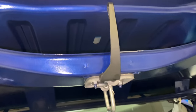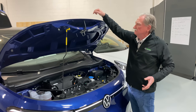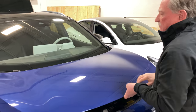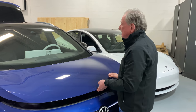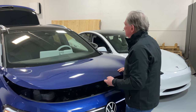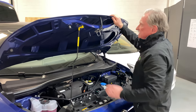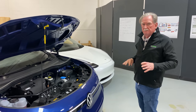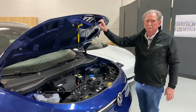You'll notice there are big air gaps here. In Europe they have a requirement for head impact — if you hit a pedestrian, their head will bang into the top here and this is supposed to deflect enough so that the person doesn't die or isn't totally incapacitated. This is something we don't normally see in North American designs, but it adds a tremendous amount of weight.